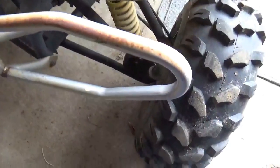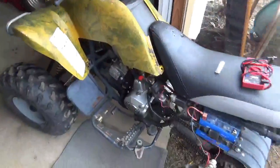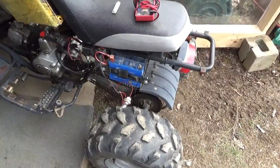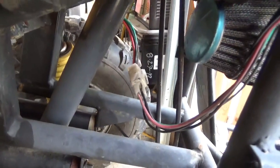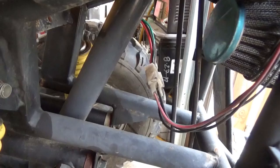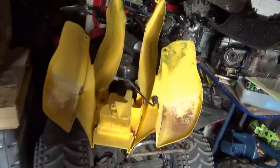Do I have headlights? With electrical problems, this kind of intermittent behavior is not uncommon - there could be a wire up against the frame and then not. That's why the light bulb in series is useful. I know I have some other problems with this thing - you can see that connector right there, it shattered. So I'm going to take the front fenders off and take a look at the wires. I'm not satisfied I can just smash a fuse in there and it'll be all good.